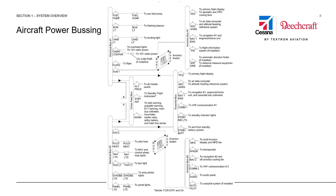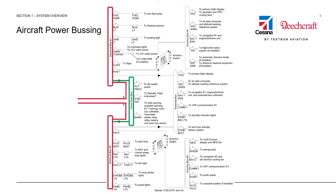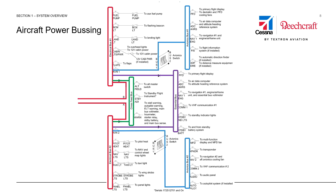This is a POH diagram that nicely shows the relationship between the aircraft buses. Note the diodes, highlighted here in red, that protect against potential back-feeding from the Crossfeed bus or the essential bus to an inoperative main bus. Also note that Feed B powers Bus 1 and Feed A from the MCU powers Bus 2. As the main buses, again in red, are powered by the feeds from the MCU, power cascades to the Crossfeed buses in green and the essential bus in purple, and also through the avionics switch to the avionics buses in blue.